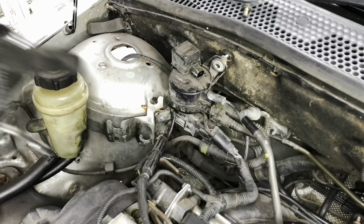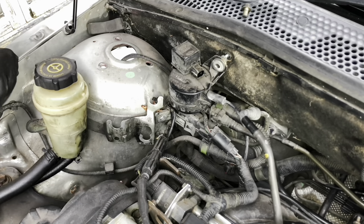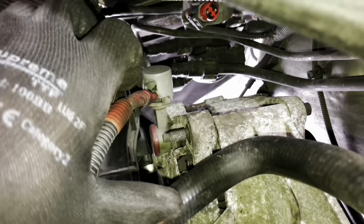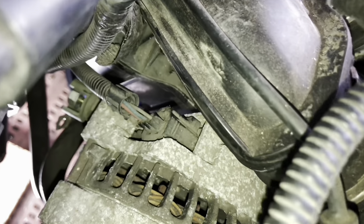I'm going to try not to bend that down first and then if I can't get the alternator out I'll bend it down. It looks like it hasn't been done before so maybe that's the original alternator. On the side of the alternator we've got the red wire coming into it with a plastic cap - pull that off and undo the nut to remove the wire. Then we've got to take out the multi-plug at the top.